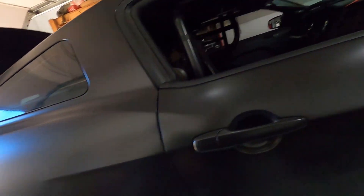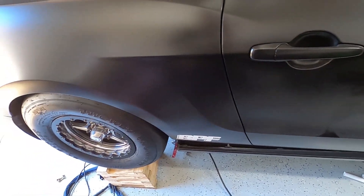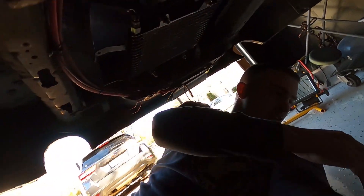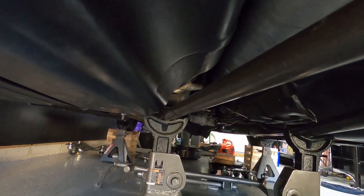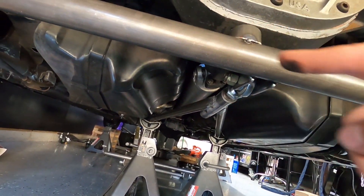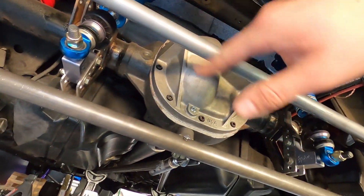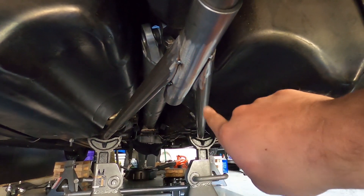I need to figure out where I'm going to place the bar that goes right here directly underneath the main hoop, straight across. It's a good thing I didn't do 18 inches because it's literally exactly perfect — here's how it's going to sit at ride height. For those who don't know what a wishbone does: it's centering the rear end instead of a panhard bar. The wishbone's going to center it. It's tacked with just tiny tacks, enough to finish mocking everything up, and I've been advised to X-brace this wishbone.